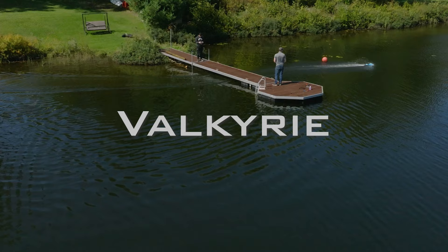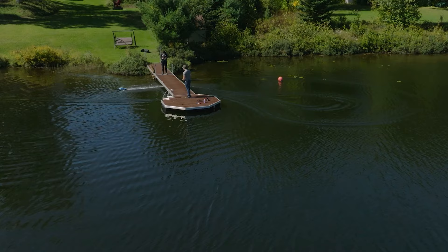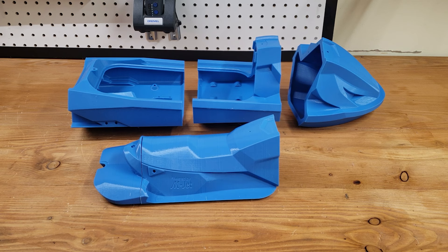There's a lot of stuff to talk about and I'm gonna go quickly over some of the details, but if you have any questions feel free to ask them down below. First thing first, you're gonna have to get all the parts you need printed. I suggest that you use a material that has high impact resistant properties because the Nitro engine vibration might cause some cracking in a brittle plastic over time. I also suggest a light color, as dark material will absorb a lot more heat from the sun and might deform if left unattended — anything but black essentially.